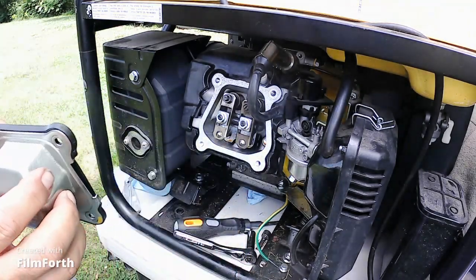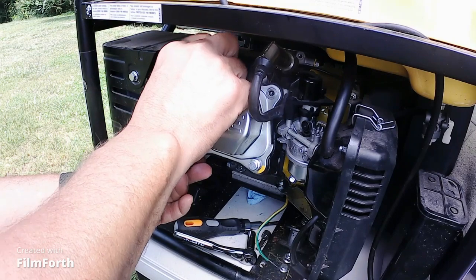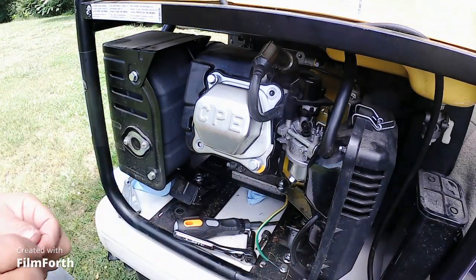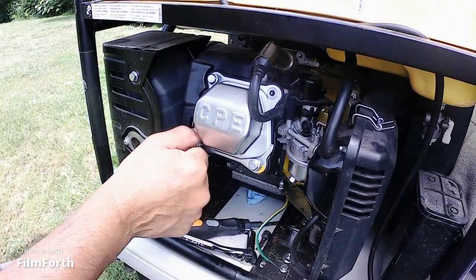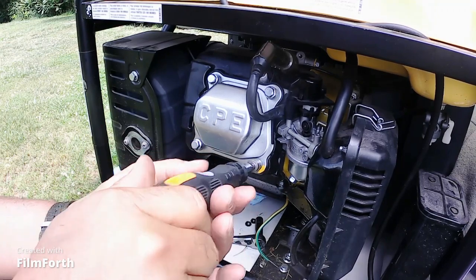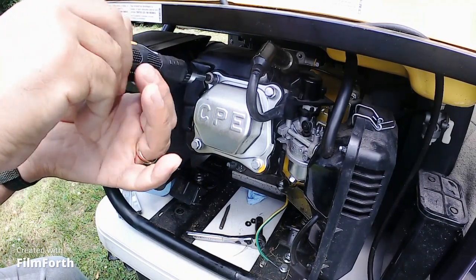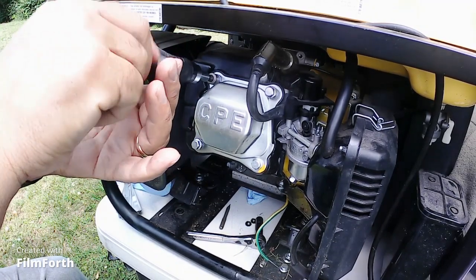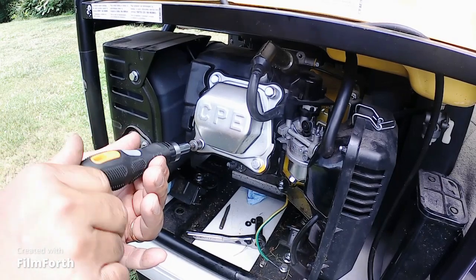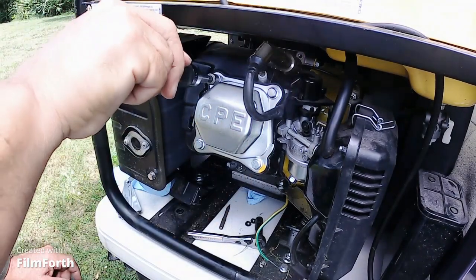All these are steel bolts, because they're magnetic, going into an aluminum housing. So you don't want to get in here and crank down on something. We're going to go ahead and do it in a diamond pattern, like a lug nut. I just made contact over there, contact right there. You see I only got two fingers on this screwdriver — I'm not ripping it. That feels nice and snug.